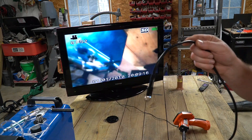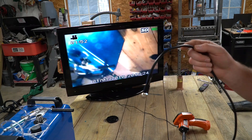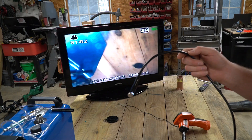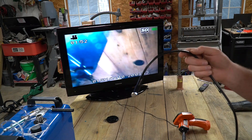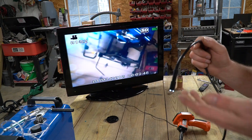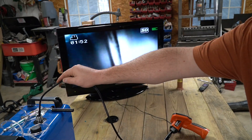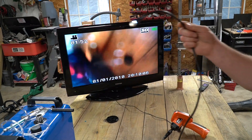The tools in that little bag are pretty cool because they work well with the camera. There's a hook tool that lets you reach down inside something and pick it up — and remember, you're watching it with the camera so you have a really good view of what you're going in to reach for, and there's a light on the end too. There's also a magnet on a stick — same thing, you just use your camera to go in and grab something. The 45-degree mirror has bailed me out on a few occasions. It's really handy if you're looking at cylinder walls — it basically allows you to look sideways out of the camera like a periscope, and it works surprisingly well. We can see on the screen that with the mirror clipped on the end, we're now looking at the walls of the canister, not the bottom.